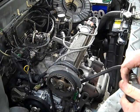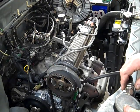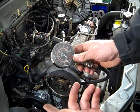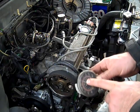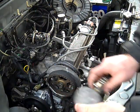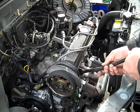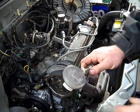So we're going to go ahead and run through this compression check right now, and then we'll plug the injector in and do it the way most people do it, and I'll show you the difference. Chris, perfect. Now that's a brand new engine — this has got probably 250 miles on it. It's almost fully broken in at 180 pounds. I'm going to go ahead and put it on and do the next one, and if we're lucky, they all read the same.